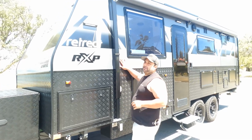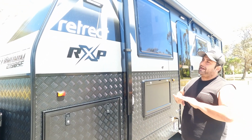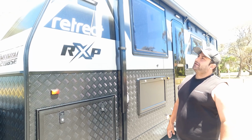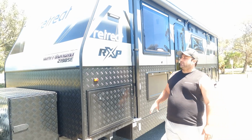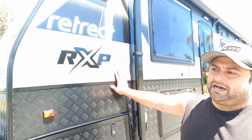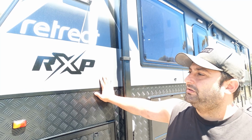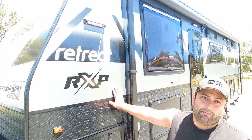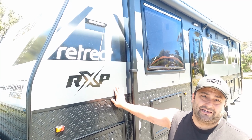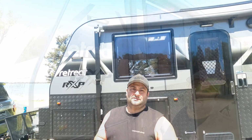Your flat ACP, which is your aluminium composite panelling, runs flat on that framework and on that XPS foam that they've got inbuilt. So really good design. It's rot free. You've got a great guarantee for warranty, as well as just having the state-of-the-art setup on your build and the way that the van has been constructed, and having that peace of mind knowing that it's all right.